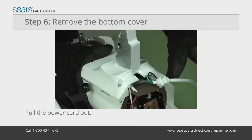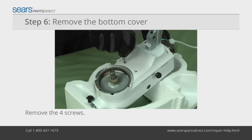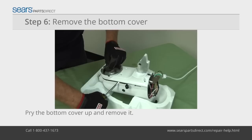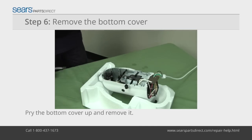Remove the power cord from the bottom cover. Remove the five screws from around the planetary gear. Remove the four mounting screws from the cover — note that one of the rear mounting screws has a lock washer. Slide the drift punch through the center shaft hole to help lift the bottom cover, then gently pry the bottom cover up and remove it.